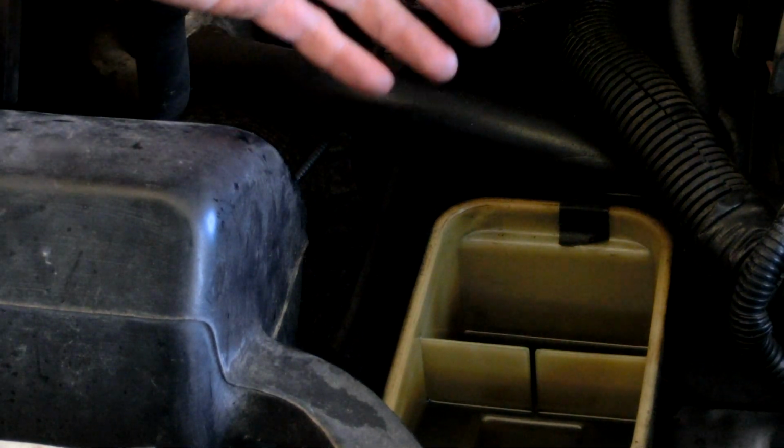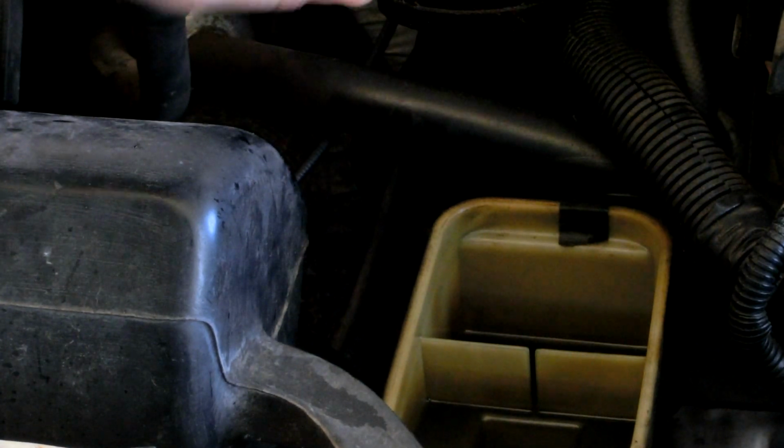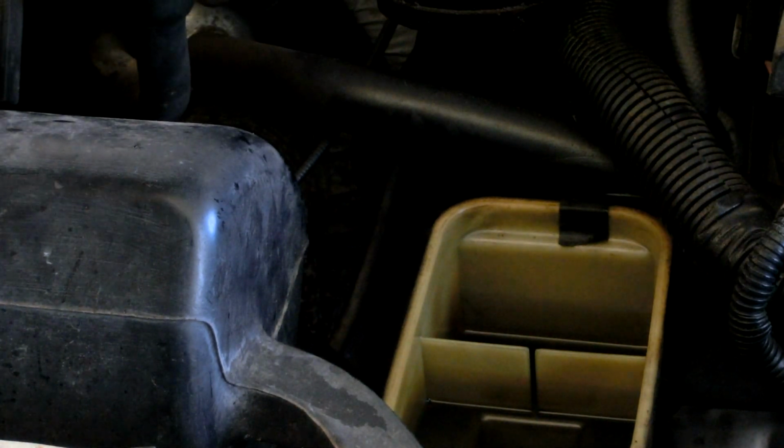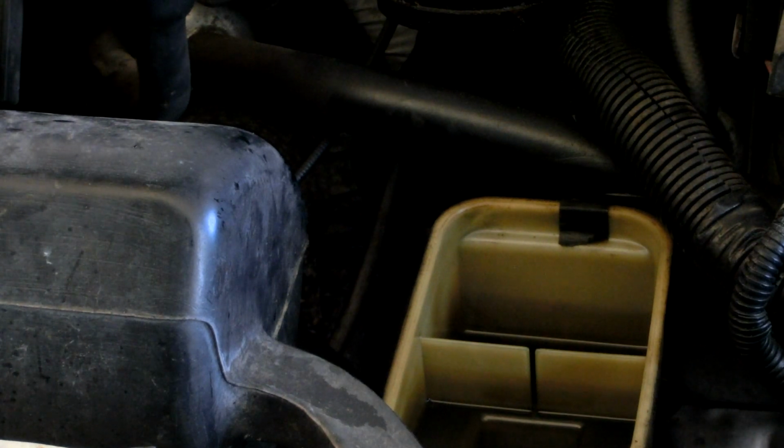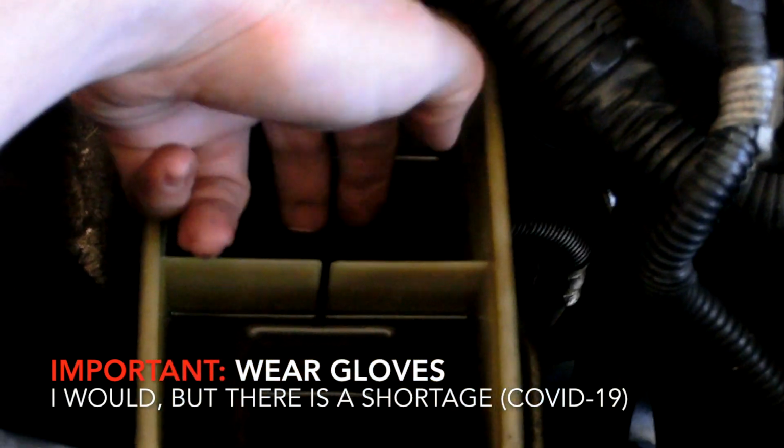Now, let's look down inside here. We've done a little bit of work on this van already, and we've drained out some brake fluid. If you've watched my previous video, we replaced a chunk of leaking rusted brake line to the back. If you haven't watched that video yet, it's a great place to learn about how to patch a brake line. But you can still see this fluid is disgusting. Back here, I'm going to maybe do something I shouldn't do and dip my finger in here. It's gross. It's black, it's slippery like brake fluid usually is, but we're going to get all that out of there.